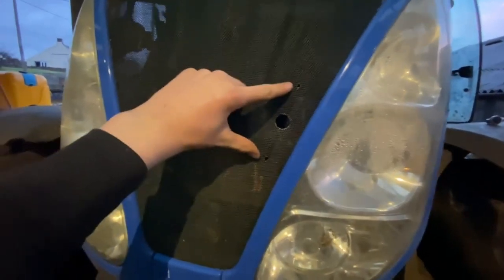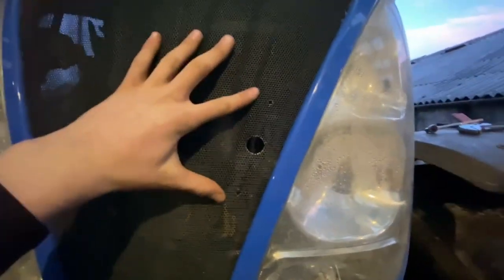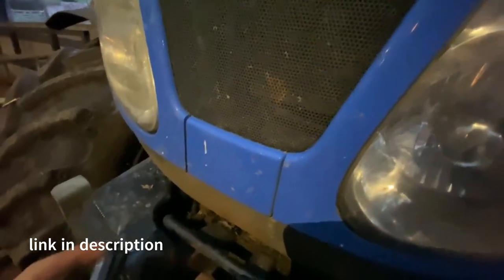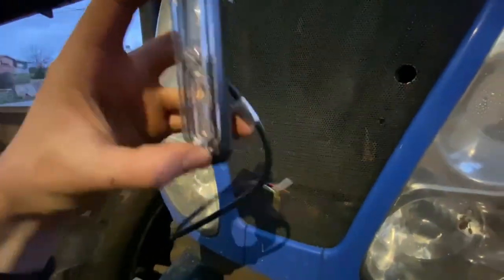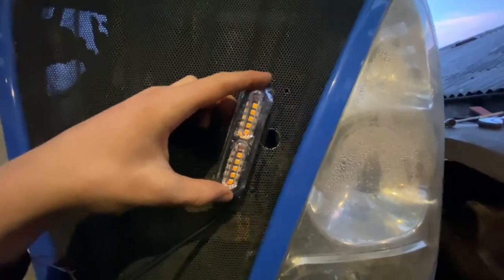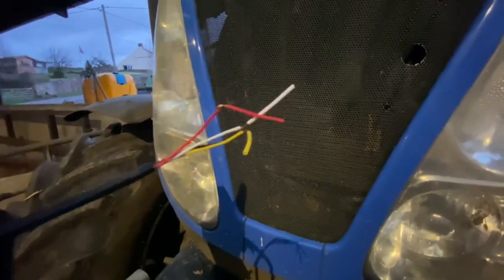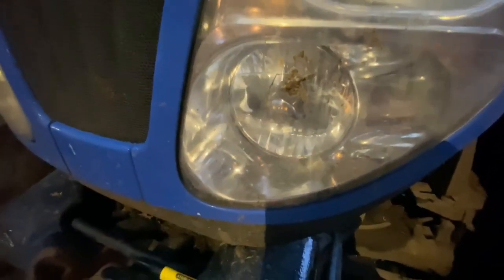So I've got my holes drilled now for the strobes. It's these middle ones I'm always nervous about drilling, because if you drill it wrong you've got a 22mm hole in your grill. But I think that should be about right. These strobes are off Amazon - I think they're £30 for four, which isn't too bad. Orange, 12 volt, they've got many different flash modes, but I'd leave them on the first flash mode because I'm not installing switches in the cab. They are fairly decent size and they don't look too bad on the grill. The first flashing stage is just a continuous flash - on, off, on, off. And they've got a sync wire - I think that's the white one.